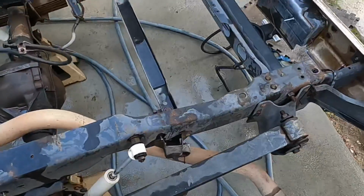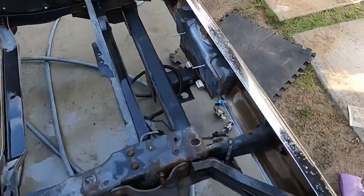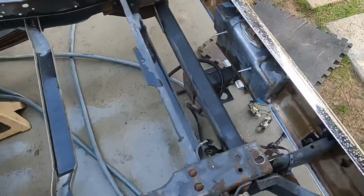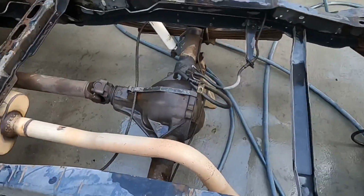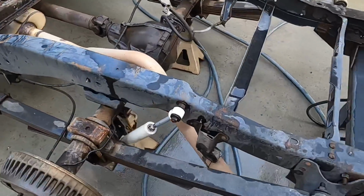And then the rear tail lights, make sure you disconnect all that, and that it's not attached to the truck bed, because some of them have little clips that are attached to the truck bed. So make sure you remove all that before taking it off, or else it won't come off, or you end up breaking something. So just be careful, guys.